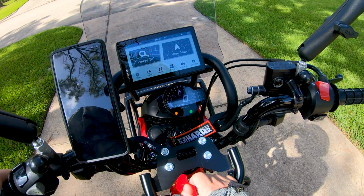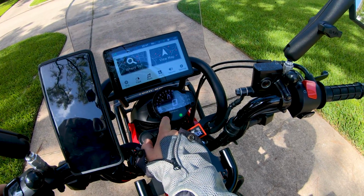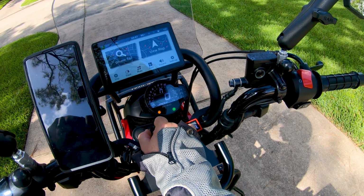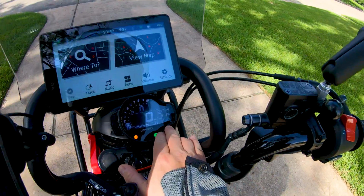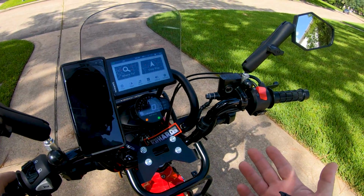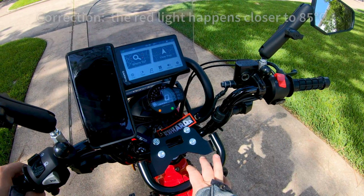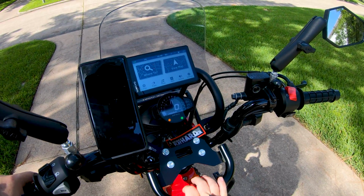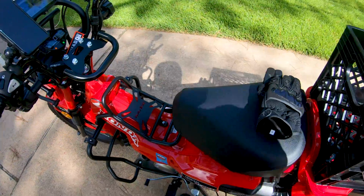I like it. The one thing that I do have to get into and reprogram in here are the warning lights. There's a shift warning light, I think, and there's also a temperature warning light that goes off almost right away when this motor heats up. So I don't know if you can see that. It's in Celsius right now, 31.2, because the engine's cold. As this sits here and warms up, when it gets up around 50 degrees Celsius, something like that, it starts flashing a red light, and I think that's just a temperature warning, but I can go in and reprogram the gauge and get rid of that. So anyway, back to the upgrades.